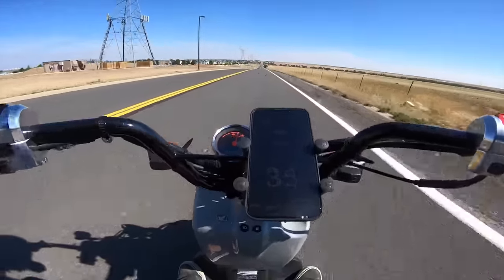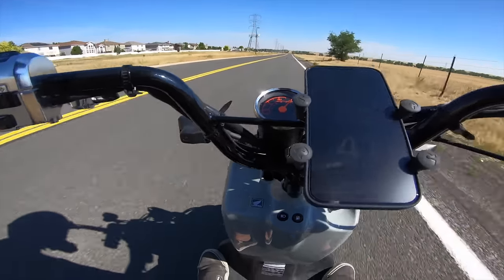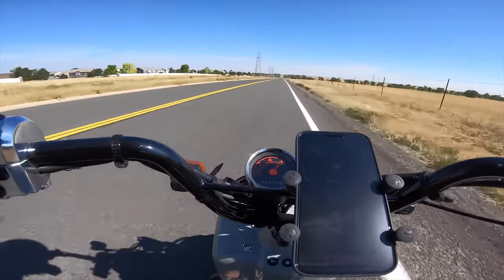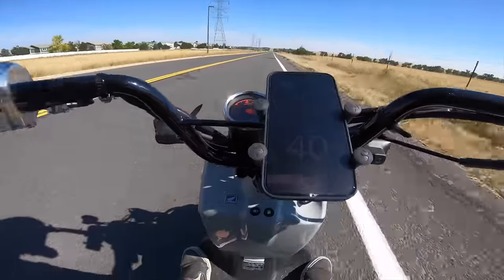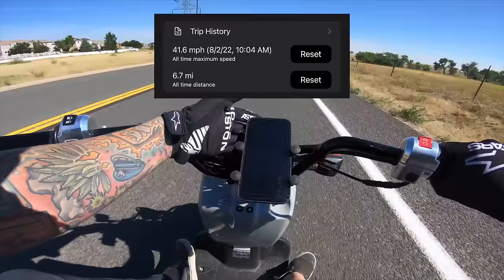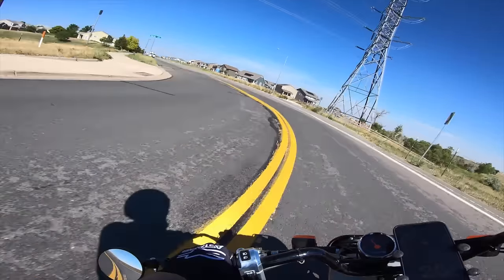Downhill. We're at 34, 35, 37, 38, 39. So 41 looks like the top speed. Since I'm wearing a helmet it's hard to tell if I'm actually hitting the rev limiter — it kind of sounds and feels like I am, but this thing is very quiet. Once we get to the stage two kit in the next video, we're going to have even more performance mods to clean up the air box, the exhaust, and a few other gadgets. That's all she's got. So 41 is the top speed — 41.6 miles per hour, 180 pound rider at 5,600 feet in elevation. Now let's go get some parts installed and see what we can make this thing do.